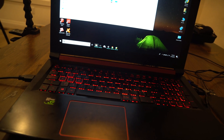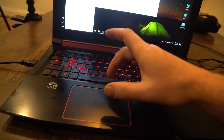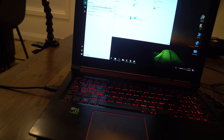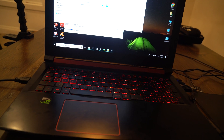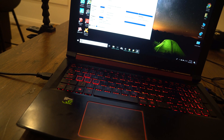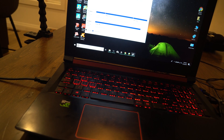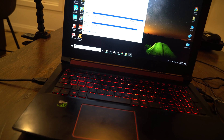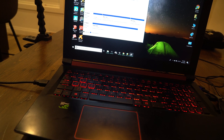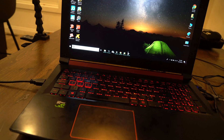If you don't see your drive here, I suggest going down to search and putting in Disk Management. Create and format hard drive partitions — this is built into your PC. You would see your secondary drive here; it would not exist yet. So right-click and hit to partition it — it'll say it right there when you click on it if it's an unpartitioned value. Go ahead and partition it by pressing Partition, leave it as NTFS. That way it shows up and your computer will read it.